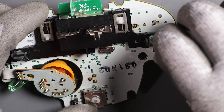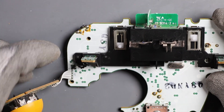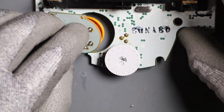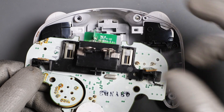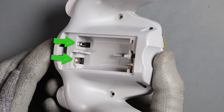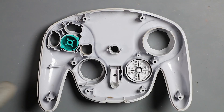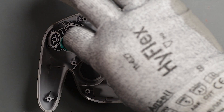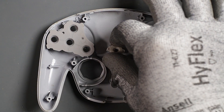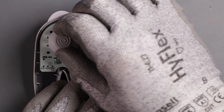Time for reassembly. Begin with putting the L and R boards back in their positions. Next, put back on the frequency dial. Swing back in the C-stick. Be sure to reset the L and R buttons. Put the board back in the back shell, making sure the battery terminals are seated properly. Install the buttons and button pads on the top shell. Put on the analog stick cover — it can only go on one way.